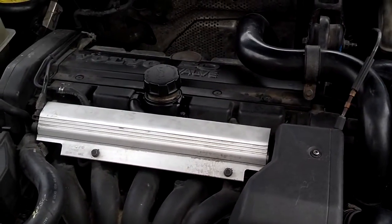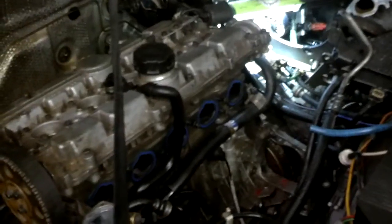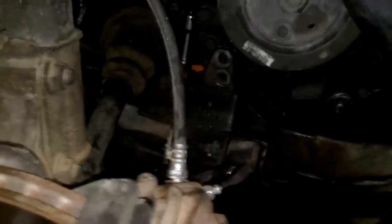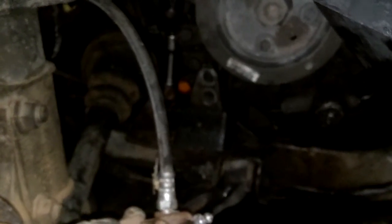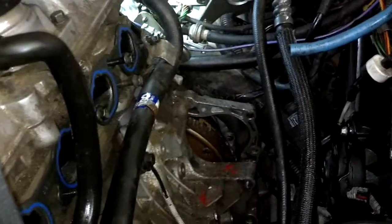This is going to take probably about eight hours to get the motor installed. I have the motor lowered in place; however, I could not do it with the front bracket on for that front hydraulic mount, or with the front motor mount installed properly. So I had to take the back bolt loose, remove the front bolt, pivot out of the way before I could get the motor to drop in place where I can get that flywheel connected to the torque converter.